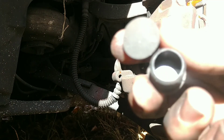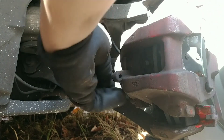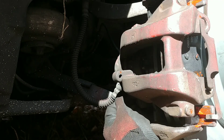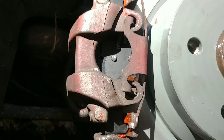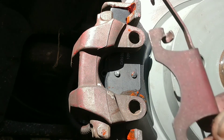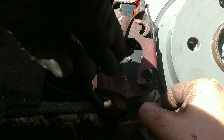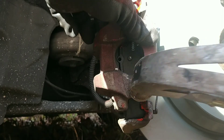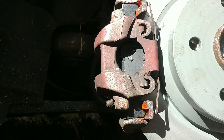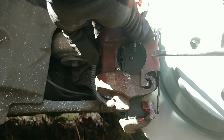Before I wrap up, these are my two dust caps for the guide pins - make sure they're nice and in. There's one, and the bottom one is right here - nice and tight. Now you do need your tensioner back on. I'll pop this out and show you how I put it on. You should get a new one but O'Reilly's didn't have one. I put it on and pry this back. I like to get my hammer and use a flat head screwdriver to push it down, making sure it's all on good.